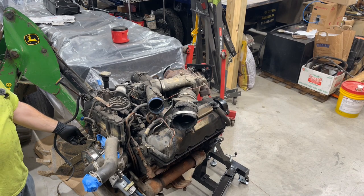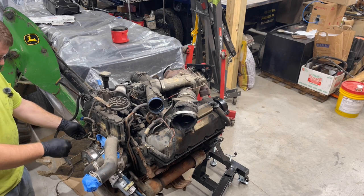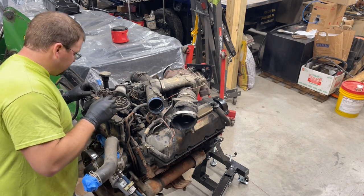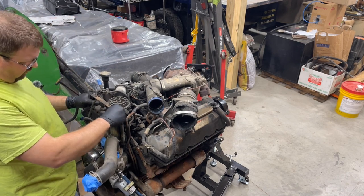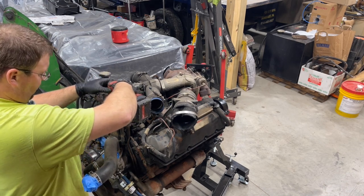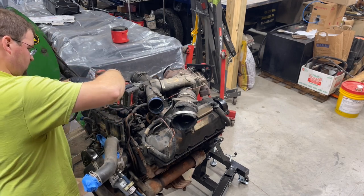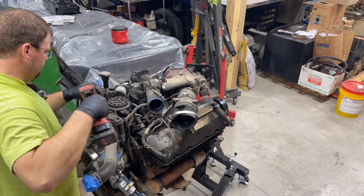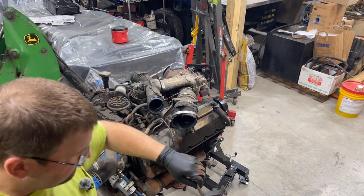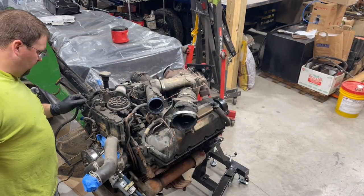So I have a saying about the exhaust back pressure tube — that would be this tube right here. The fitting on the end of it likes to not come out of the manifold, so that was what we needed the heat for. The next order of business is this bracket on the top here. We can go ahead and take that off because it's in the way, and we won't be using a beauty cover on this. I don't even know where the beauty cover went for this truck — I don't even know if it ever had one.